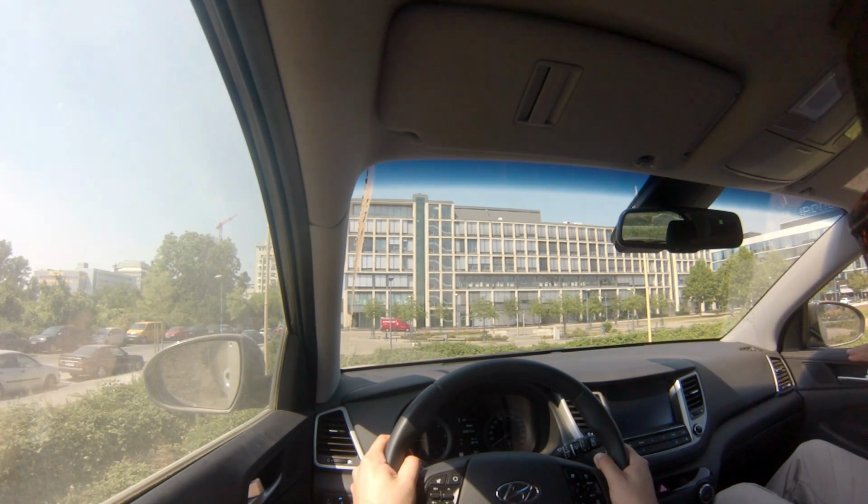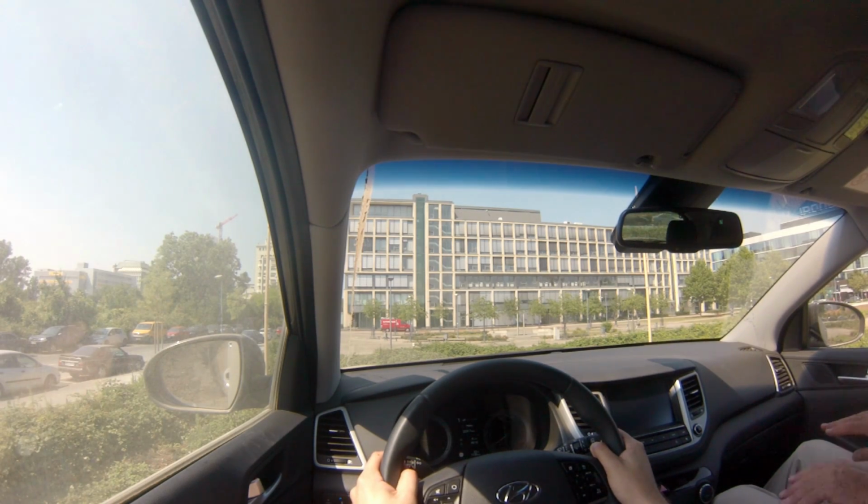Okay, that's good. Now from here, while we're sitting horizontally, our hill descent function is engaged, but it's in passive mode. As soon as you hit an incline, either pointing down or going up, it becomes active, ready to work. If we go straight into going downhill, the vehicle will take off really quickly, to 7 kilometers an hour, and then the system will start working and slowing us. But by that time it's traveling quite fast, and the system then has to work even harder to slow it down. However, if you just edge over the top here, so it goes from being flat to on a slight angle, that makes the system active, because it now knows it's on a slope, and it will react a lot quicker as you go down.